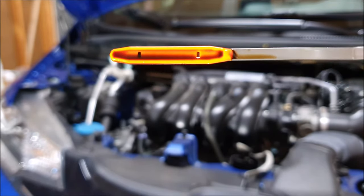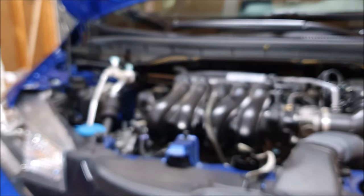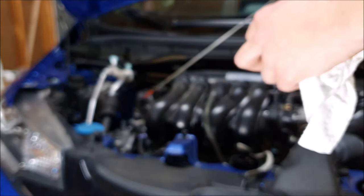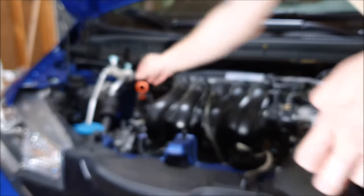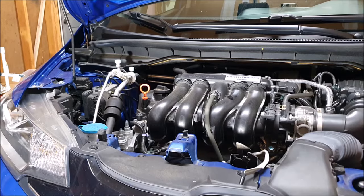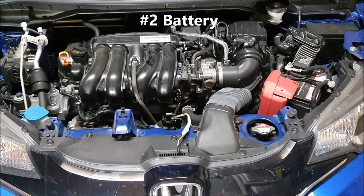But if it's towards the low side, we should add some oil — that's a topic for another video, but it is important to keep our oil level good. We can lose oil in the engine due to two things: either through a leak or through burning off oil. Even well-running engines will burn a little bit of oil, particularly if you're running the engine hard. So definitely be aware to check your oil level.